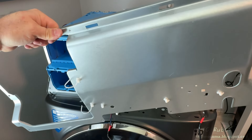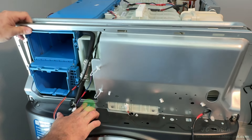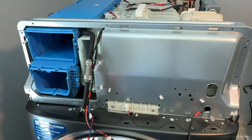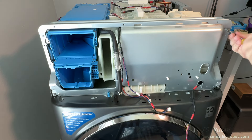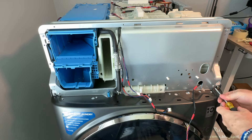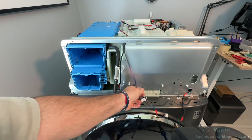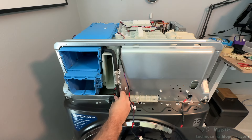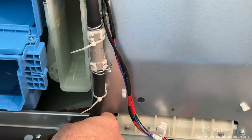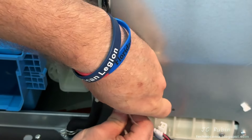The outer shield is now installed — negotiating the hose and cables through, setting it in position ensuring it is behind that blue pipe on the bottom, then pressing into position with cables out of the way. Screws 13 through 18 are installed to secure it, about three quarters of the way, at which point all screws are gently torqued down. The front shield installed, the hose is pressed back onto the barb fitting, two loosely fit cable ties are reattached around the hose, and the hose clamp is brought down into position and secured over the barb fitting. Additional cable ties are replaced on the cover.